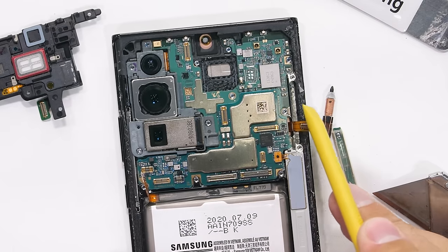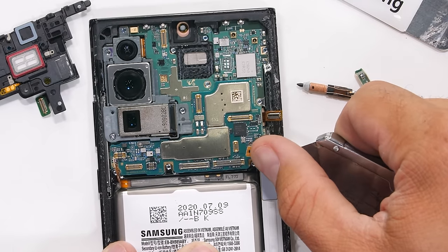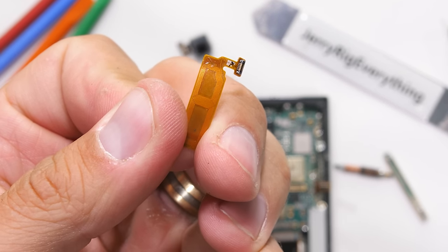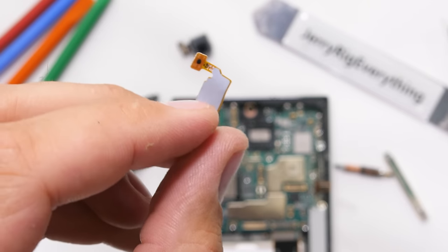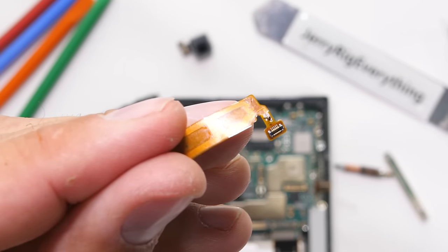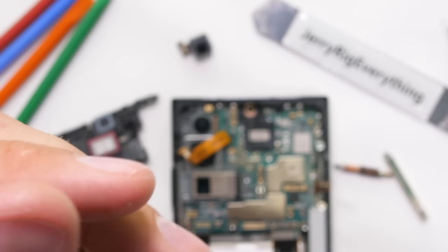Back to the cute little wireless charger over the S Pen slot. I can unstick that from the pin sheath, and it's about what we'd expect — a bunch of tiny copper coils making an electromagnetic field that the tiny coils on the S Pen tip can use to charge up the tiny capacitor at the end of the pen.